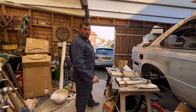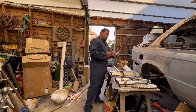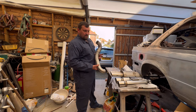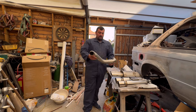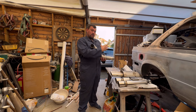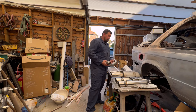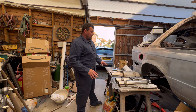I don't really want to pay somebody to do this because I've got a welder and I like messing with cars, so I'm going to do it myself. My solution is basically this: I've got two 90-degree dairy bends, I've had to shave one back. These are going to get welded onto what I think is a 15-degree bend — I'll double check and put everything in the comments so you know exactly what I've used. That's basically going to fit on the back section of the exhaust I've cut, giving you a little dog leg to clear the rear subframe mount. I think I'll start the car so you can see what it sounds like, then we'll get it jacked up, get the old back box cut off, and crack on with it.